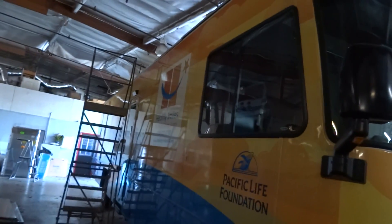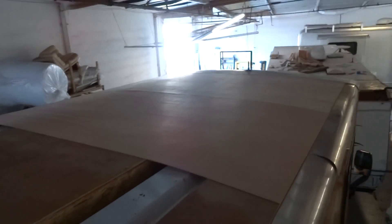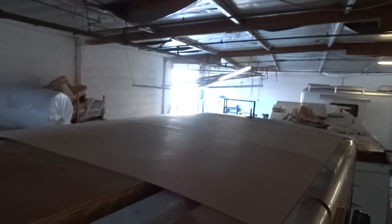We've got another coach here — this Healthy Smiles. Doing quite a bit of work to it too. It's a complete new rubber roof we're putting on here. So this one here we had to put new flashing on — these metal pieces were bent up, so those are put on. And then we're re-skinning. You can see the new wood skins here — it's eighth inch birch, smooth one side. We're re-skinning this roof front to back with that new birch, and then we need to lay the rubber roof down so the glue can stick and there's no air pockets. You can see all the ACs have been removed — everything from the top of this roof. So that's going back together too.